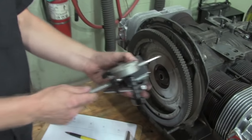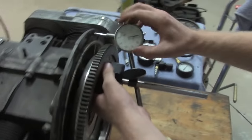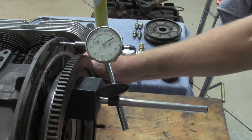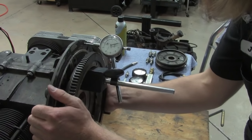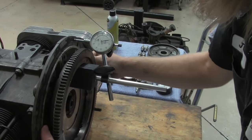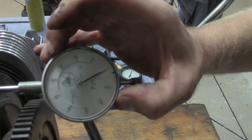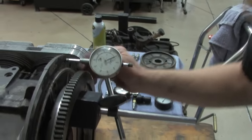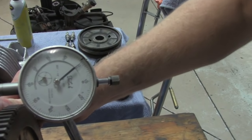You're going to have to use a dial indicator. Get your clutch off — it's easier to get it stuck onto the flywheel that way. You're going to bring it around until the dial indicator reads zero, pull all the way back, make sure it's seated and reset your zero, then push forward. This has got about five thousandths of end play, which is well within spec.